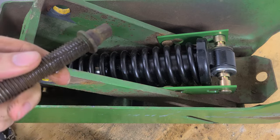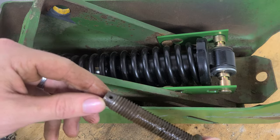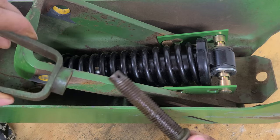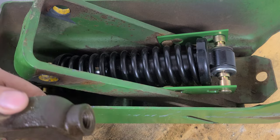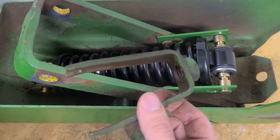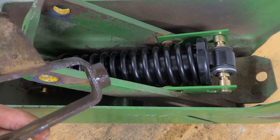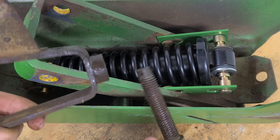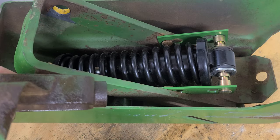There's supposed to be a roll pin in here. When I took this apart there was barely any sticking out, such that I didn't even know there was a roll pin in it. I tried threading this out and since it was sticking out, I totally boogered up the threads on these two pieces. Rather than buying a new piece, I bought a tap for this — it is a left-handed thread. It's a 5/8-11 left-hand thread. I ran the tap down it, got it cleaned up, and the bolt goes through mostly nicely.